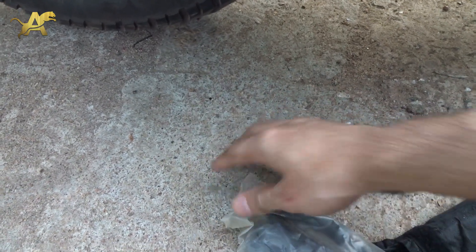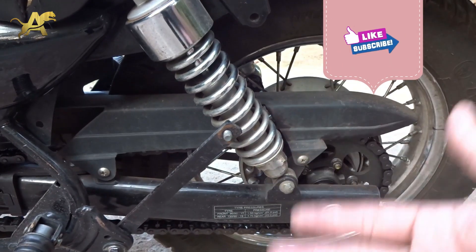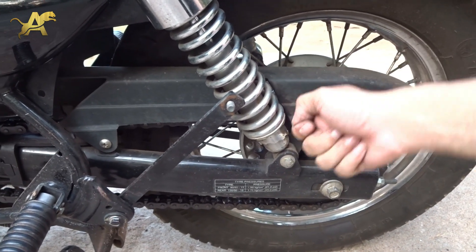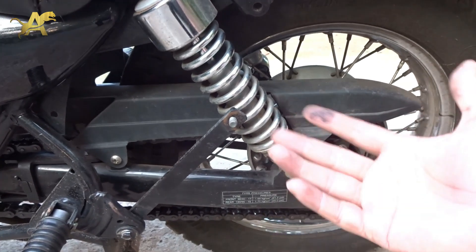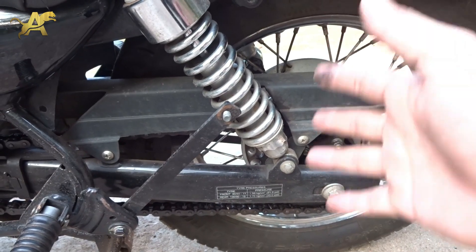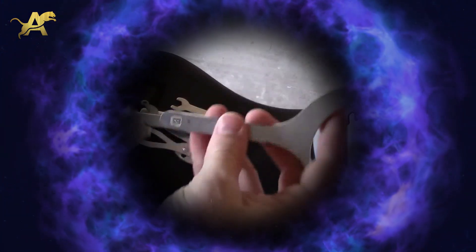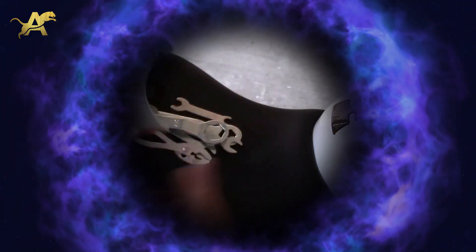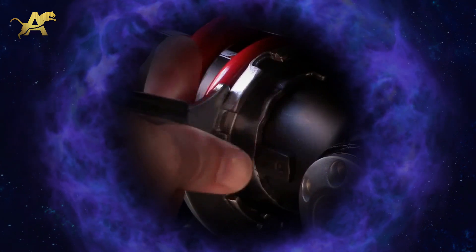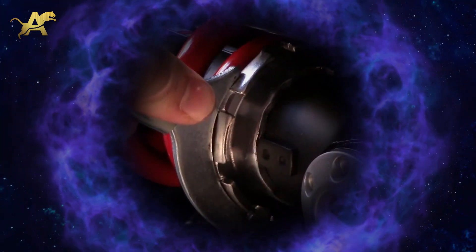To increase tension — the distance between your suspension and the frame — you increase the tension of your shock absorber using a clamp from the tool kit. Put the clamp on the shock absorber's locking ring and turn it counter-clockwise to adjust the sag. You can increase or decrease it depending on the load. The more load on the bike, the more tension you apply.